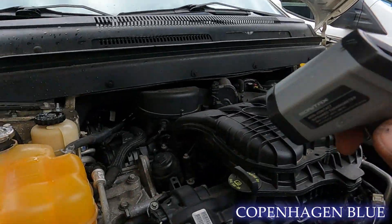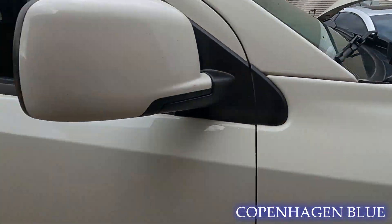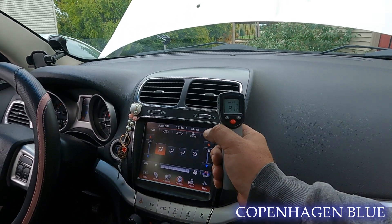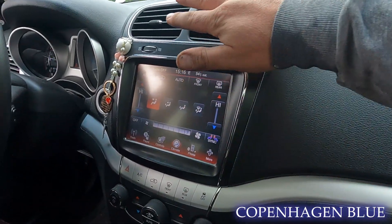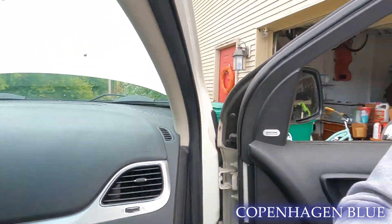Here's where we're at. I've drained it twice out of the motor and put water back in up top, with the system up by the thermostat. Let's go inside the car and see what we're getting heat-wise. We're getting 86-87 on one side and 85-90 on the other — it's hot. It's definitely pretty much as hot as the other one so maybe I got lucky. It'd be really awesome if just a flush made all the difference, but I'm going to drain it one more time, put in some coolant flush, and see if we can get it even better.